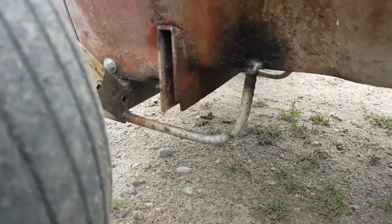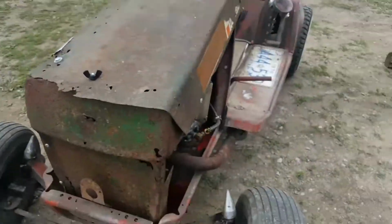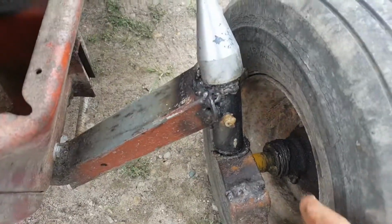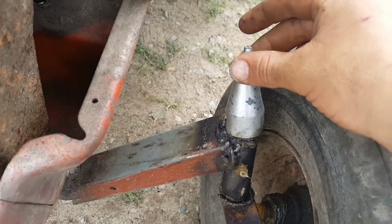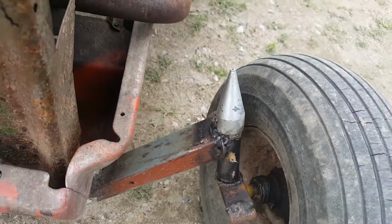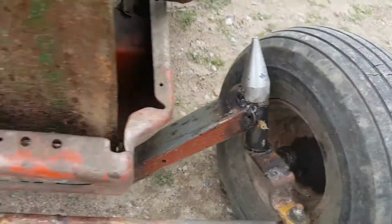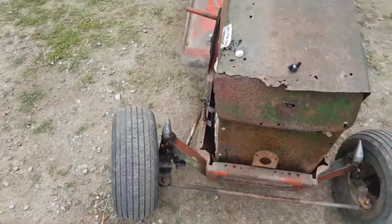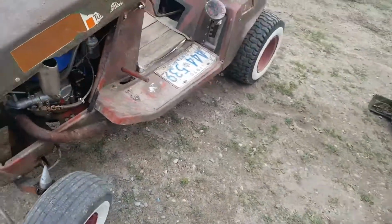I actually cut those rebar support things for the front axle. I figured why not. And grease fittings. I have grease fittings on those spindle knuckles because it also has my pointy dust covers. I know Mighty Rays likes those, so I think they look kind of neat. But anyway, they're greasable, the spindle knuckles are, so I figured that cut down on wear a little bit.